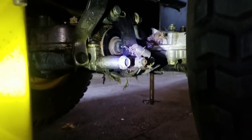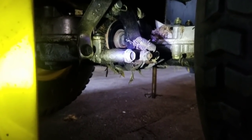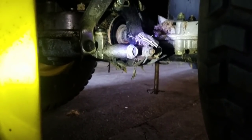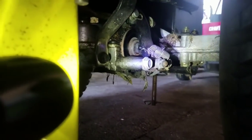I'm going to put the flashlight there so you can kind of see. I'm going to depress the brake — see how that moves? It's kind of hard to move. And as you can see, when I'm moving it, the black lever doesn't really move. So I think that nut is too tight.